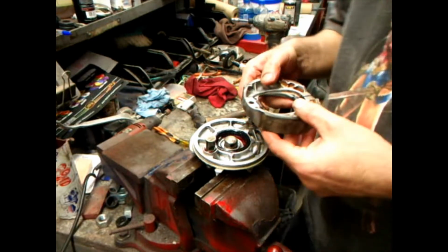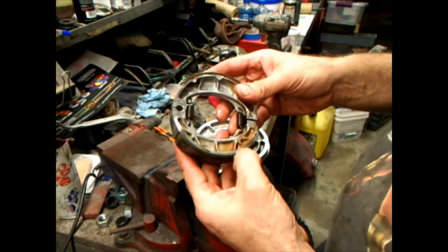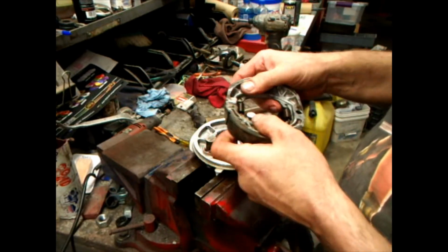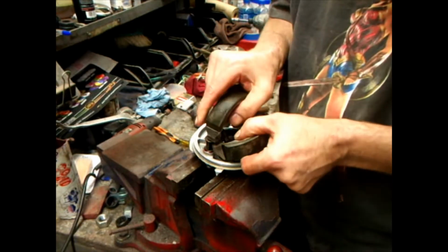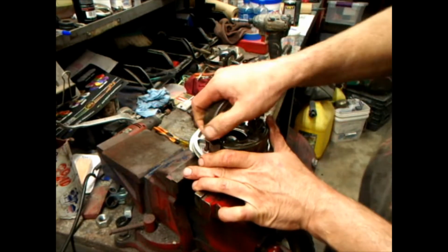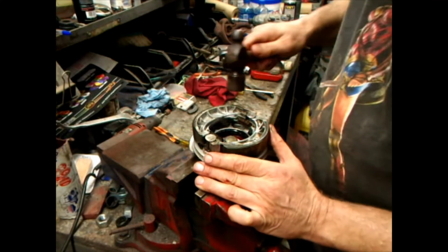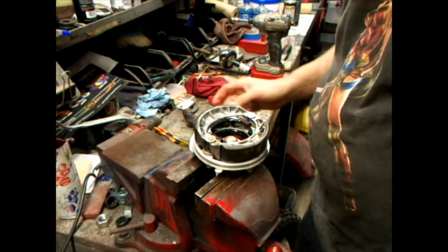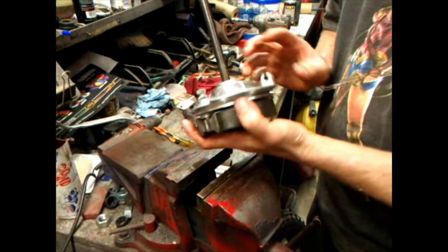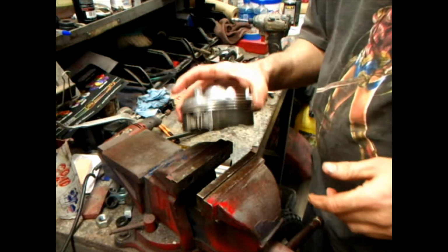So I get the brake shoes on. I already got them cleaned up, you know, relatively good. Scrubbed them best I could, rinsed them off. I've already somewhat broke the glaze on there. But anyway, so the springs attached, flats on there. Let it flip over. Little tappy tap goes right in. All right, ain't much. It's harder getting them off than it is getting it on. So, you know, whoop-de-doo.